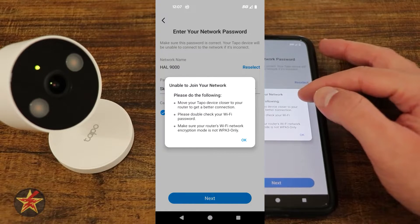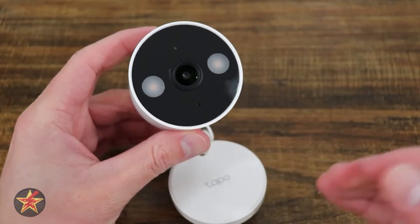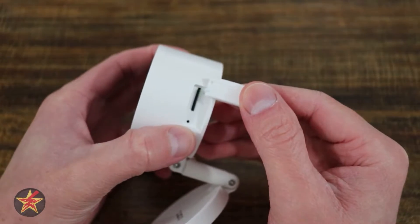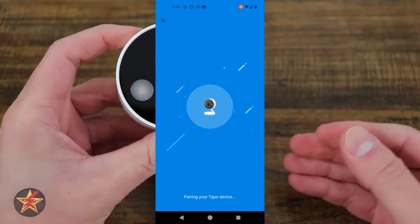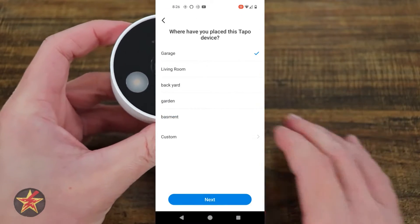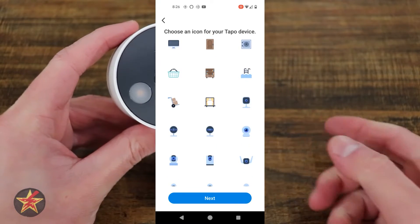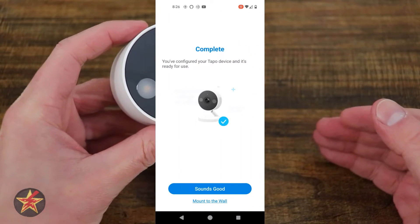It's saying it's unable to join. I did hit a wall setting up the C120 and I got frustrated. I had tried to set up several times, and what I ended up doing — and this is why I said it was important — was the hard reset on the side. After I reset the device using that, I was able to proceed through the rest of the setup process as I have with every other Tapo camera. I'm not sure why I ran into this particular issue unlike other Tapo cameras, but learn from my experience: when in doubt, just reset it and try again and you should have no issues with the setup process.